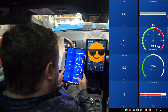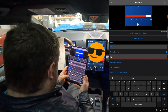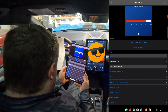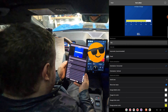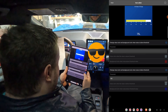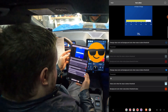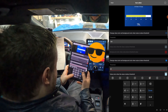Now let's go to 12-volt Battery State of Charge — double-tap — and rename this to 12-Volt State of Charge. I want that bar to be yellow, so go to Scale and Pointer and pick a nice yellow. Then go to Visual Warnings and change the value color when background is below threshold. When it's less than 30% battery, I want it to turn red. Let's do a quick test — set this to 90 and you can see it turns red. Set it back to 30.